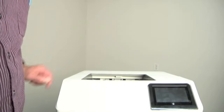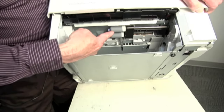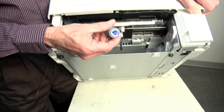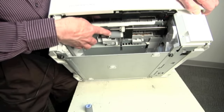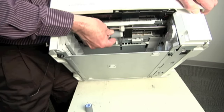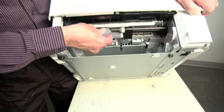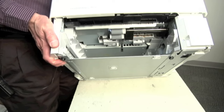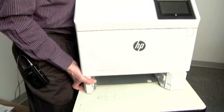Another common one — we do have other rollers inside here. I'm going to tilt my printer up so you can see inside. I also have my feed roller and my pickup roller. My feed roller has the little tab on it so I can pinch it, slide it off — should look very similar to what we just had. Get my new one, put it back on. Some maintenance kits will have the pickup roller; in the OEM kits you do not have a pickup roller, but the tab is different — it's on the inside of the hub — and there's also a white hub so you can see the tab. So when I put these back on, I get them both in. Did I get them both in? Give them both a tug? Yes, I did. So I'm good with the rollers here. What happens if I don't install them right — say I don't give them a tug and one is loose? What's going to be the complaint? You got it. Paper jam. And you're going to go, dang, I'll bet you I didn't check the rollers.